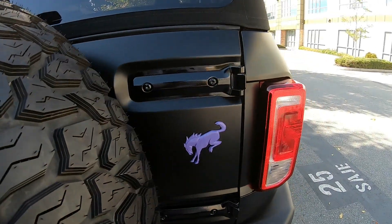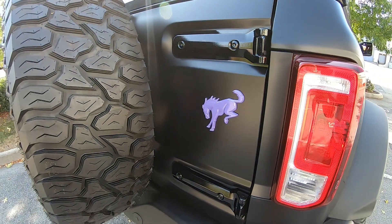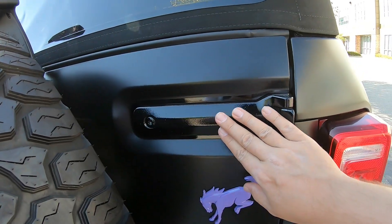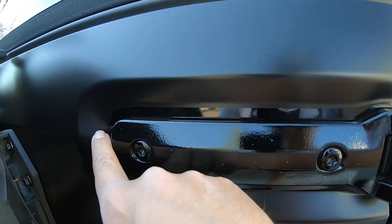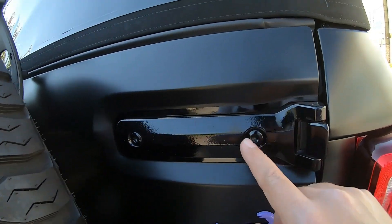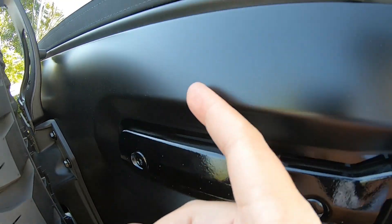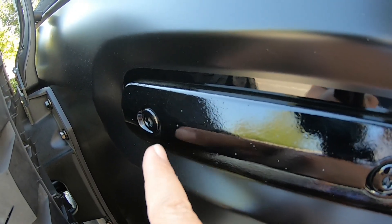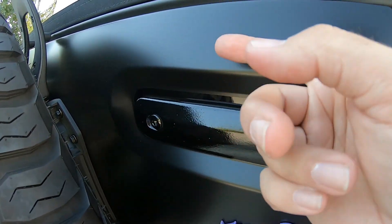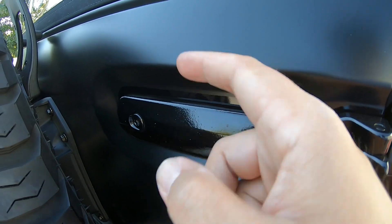On the other side, the rear emblem — the Kickin' Bronco — was taken off and painted purple to match the rest. It all comes together nicely. On the rear, you probably won't notice unless I say so, but we did not wrap the hinges. They left a little bit of space around there as well. That's because the Ford lettering is really etched in from the factory on the steel hinge — if you put satin wrap over it, anything underneath would stand out like a sore thumb. We also left it off so that if the hinge ever needs to be loosened to remove the door, you don't have to worry about the wrap rubbing and getting ruined.